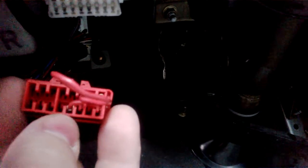What we're doing is taking this top right pin here — this is pin 9. 2000 Xterras and Frontiers are a little bit different; they use pin 8. So be aware of that, as some 2000 models may require a different pin. Then I take it to ground — both of these here in the middle and the bottom are ground. You can also take it straight to your body if you felt like doing it that way.